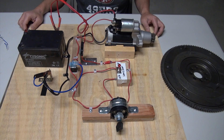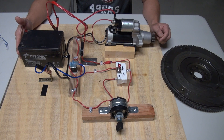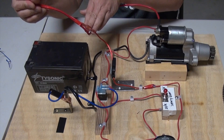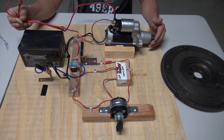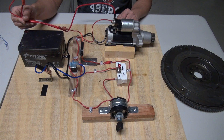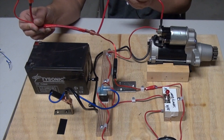Now let's go into the wiring. Starting with the battery — you see the positive terminal and the negative terminal, with two lines coming off the positive terminal. The bigger wire is designed to carry more amps, because the starter needs quite a bit of amperage to get started. In a typical vehicle, the amperage needed to get it going is typically 125 amps to 400 amps depending on the weather. If you try to start your car on a cold day it could take 400 amps or more, and that's why those wires are huge.